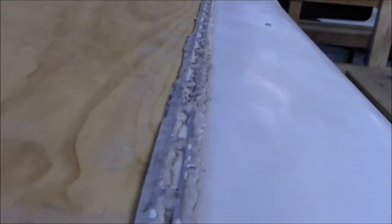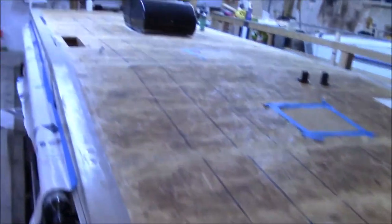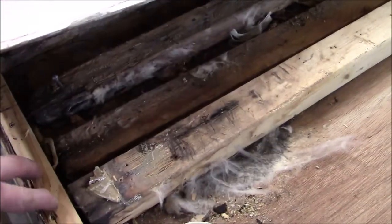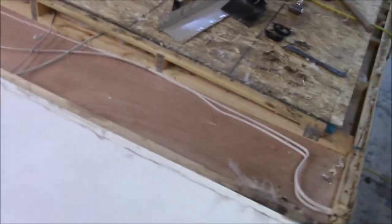You can see how this has a heck of a belly on it like that, and I don't want water sitting there - it's just going to be problematic. There's some rot on this here right in the front. You can see it goes over that way. This seems okay, but this seems rotted - it's at a different elevation. That's where the problem was. When they did this transition they just screwed it down to here, but it actually needed to come up about an inch or so.